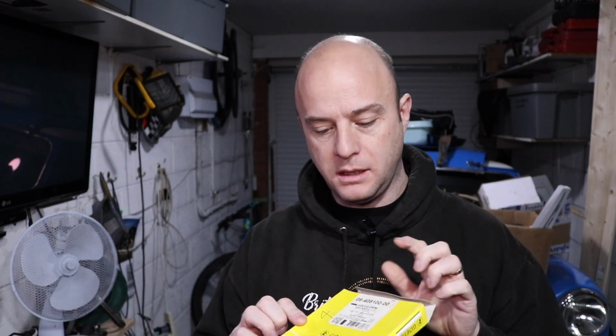So I've just been through a load of measurements on the block. I've measured the bore to confirm it's 96 millimeters, and I've measured the ring gaps. Now, these boxes of piston rings came with the engine as brand new rings. Three boxes, three cylinders' worth, look brand new, one don't. So I've put them in the bore and I've taken some measurements from a couple of different locations.